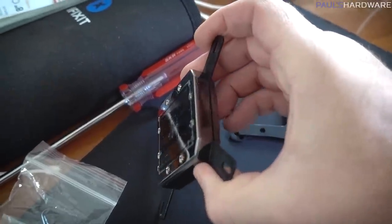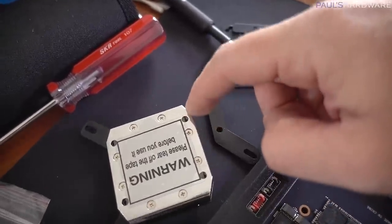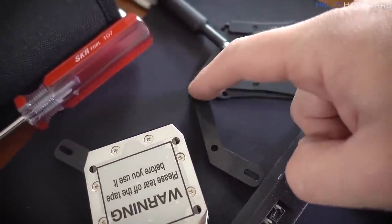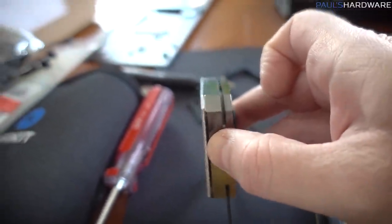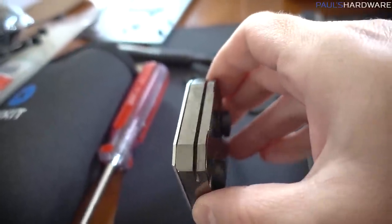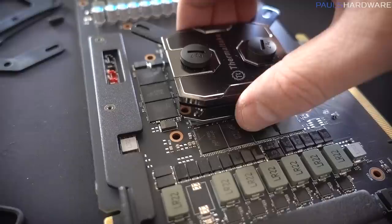The way these hold-down brackets on the block are designed, they pull out like that, and they're held on with these little plug screws that drill in through the bottom. That's actually kind of useful for me. When you do it normally, it goes through these little holes and provides pretty good security. But what I'm looking at is this channel through here. If I could get a piece of metal that was straight and sturdy enough and feed it through there, I could put those screws through and hold it down, although I might need to cut them short depending on how far they protrude.